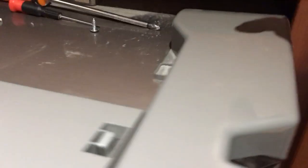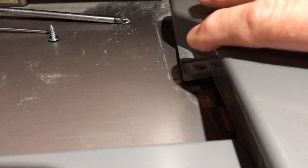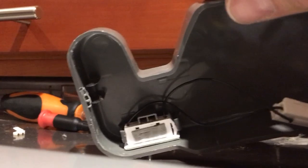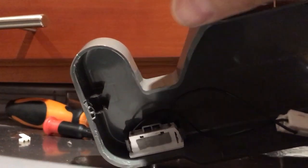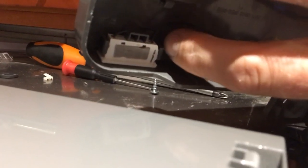So how did I fix it? Let's go back up here again. I've undone the screw on this and lift it up. Be careful because there's lots of cables under here. Your issue will be that there — that is the magnetic switch, which when it's on here makes contact at a distance with that magnet there. You can test to see if it's this by opening the fridge and getting a magnet. Take that magnet out — it pops out quite easily. You might have to push the tab back a bit and hold it against it.